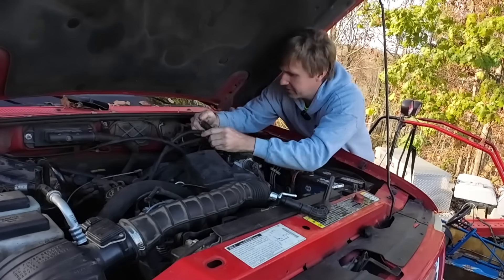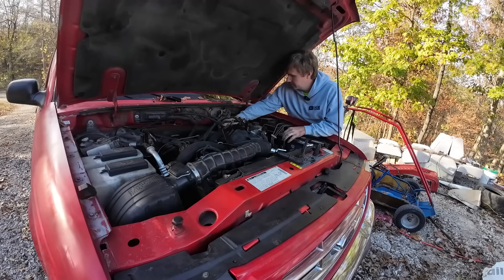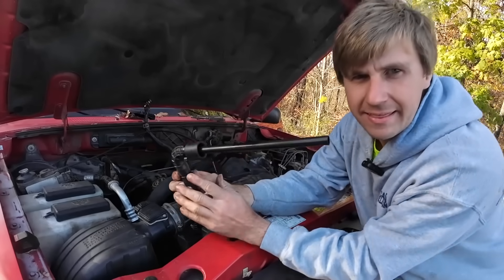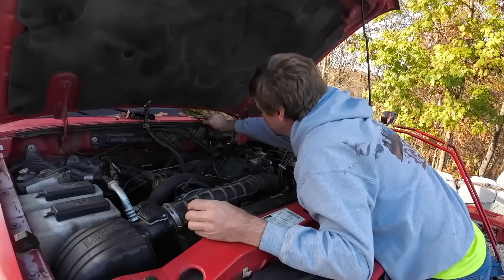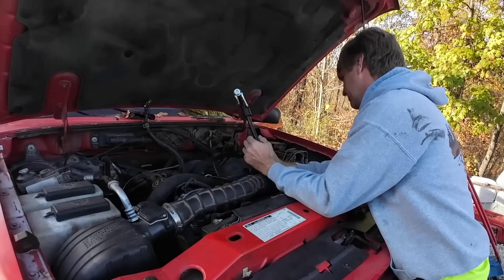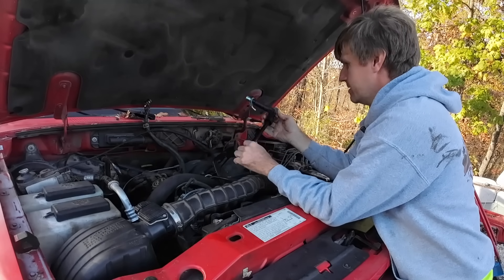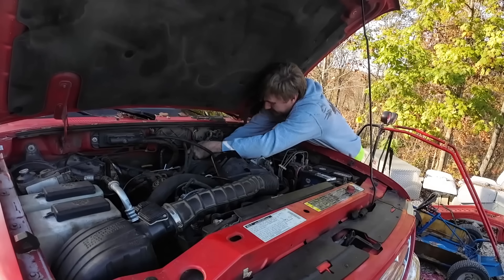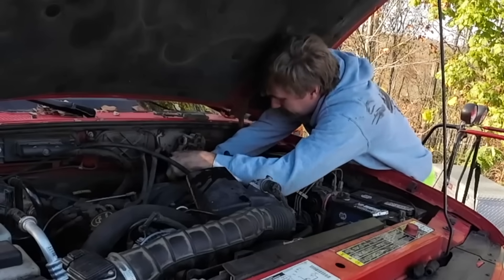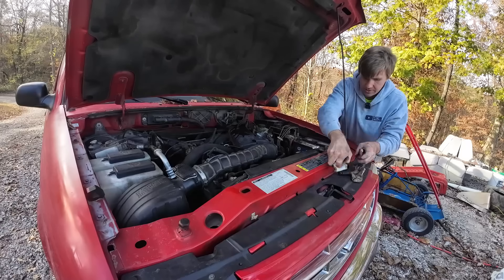So I picked up another one — it was only about 50 bucks. Got to get these clamps off. I'm also realizing a huge problem: how am I going to get that in there? Do I have to take the intake off? I've got this length of tube and it's too long to get in there. See the problem? It's probably designed to go in as a whole unit, but it's got some flex to it. I bet if a fellow was careful he could slowly feed it around and try to keep it from kinking. And look at that — she fits!